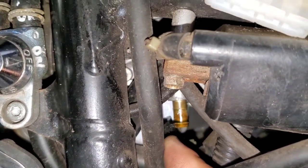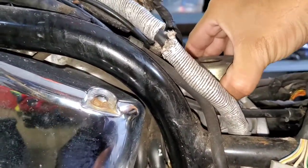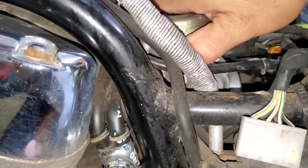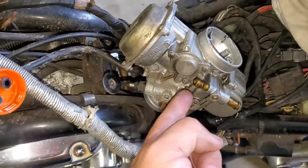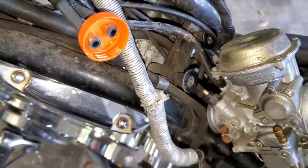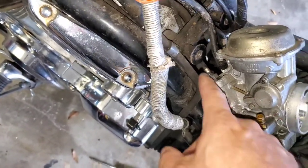I'm going to give power to the bike, turn it over, and see if that fuel line shoots anything out to confirm the pump works. First let me see if I can pull the carb off — just grab it, give a few pulls, and loosen it out of there. It's been on there a long time so I might need two hands. I disconnected the one fuel line that feeds the other carb up top, and that allowed me to pull this out comfortably. The clamp stayed down on the intake boot, which worked out perfectly.